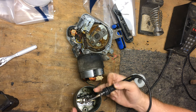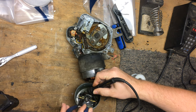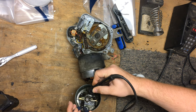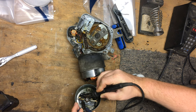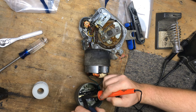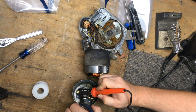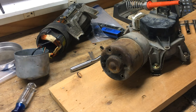The first electrical step in the process is to get that broken brush and its copper wire removed out of the wiper motor. I'm using a pencil-tipped soldering iron with the soldering station — that didn't work. I had to move to a 40-watt blunt-tipped soldering iron in order to have enough heat to get it out. So there's the broken brush.